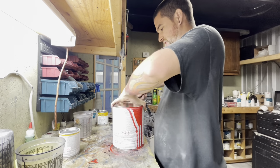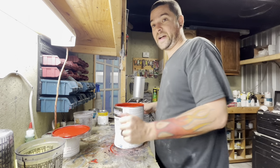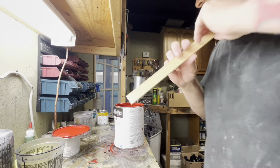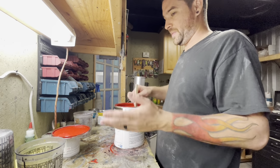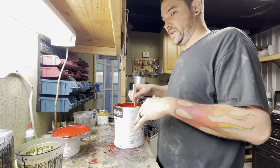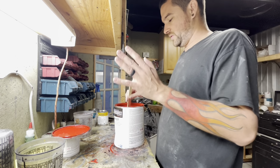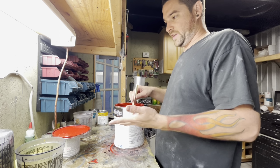We're not gonna mess with the taillights right now. They're just gonna sit there and hang out. They're gonna get done towards the end of the clear coat. You don't wanna be jumping back and forth. You don't want tinted clear coat on the bumper, and you don't want red paint on the taillight. So we're gonna run the bumper completely, VAP seal, base coat, and then clear coat.